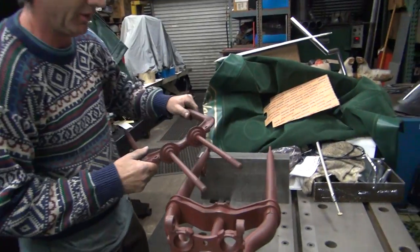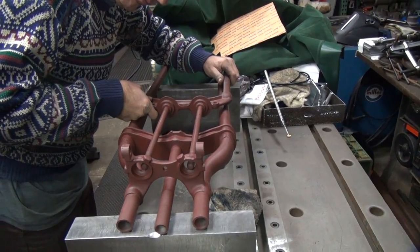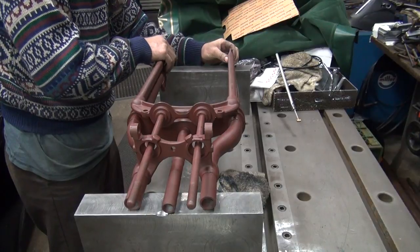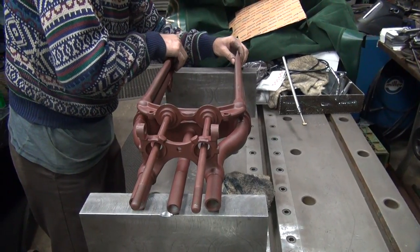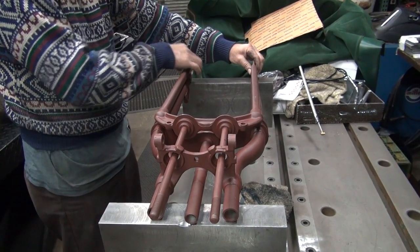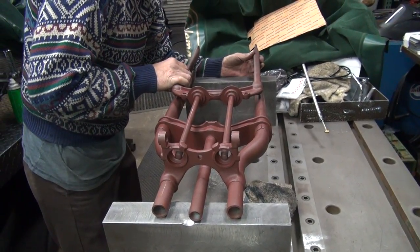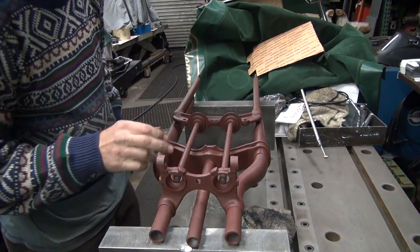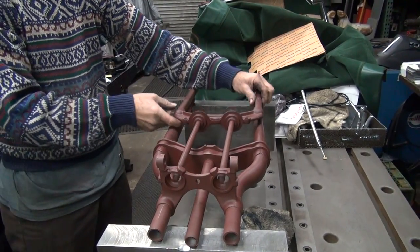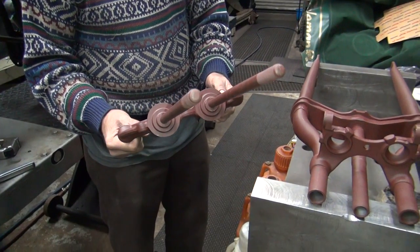I think I just bend it. Just quit screwing around and bend it, I think is all we need to do. Except we're not doing much. It's bending, but it's just all springback. See, we got that same 30 or 40 thou. And that's what we need up here. You know, just a little off center there. Now, if you just let it kind of be like that, then it's going to wear the balls even back out. Because those are your balls, if you look at them, have a big, huge wear spot in them where they should never be worn.